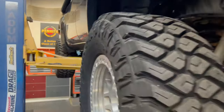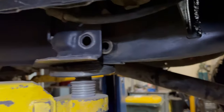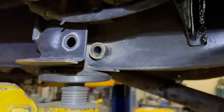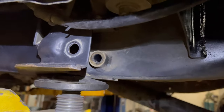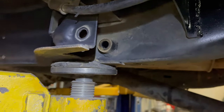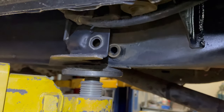There are fair few benefits for the price. Either way, when you get a lift bigger than two inches in the rear you need to change the arms - usually people just go 20mm longer which corrects the lift size, but you're paying money for them anyway, so you may as well fork out the extra couple hundred dollars for the long arm kit and get some actual benefits. Now that's done I'm going to lower the car and cut off these mounts - I'll cut around the perimeter leaving about 5-10mm of steel so I don't score into the chassis, then grind it back slowly from there.